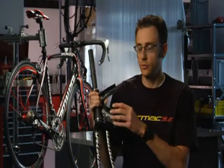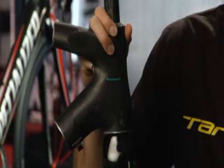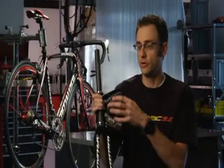On the frame, it allows you to really pump up the diameter of your head tube at the bottom, and also your down tube diameter, which really helps increase the torsional stiffness of the whole frame and results in a more precise handling machine — and also a frame that reacts better when you're out of the saddle and pedaling.